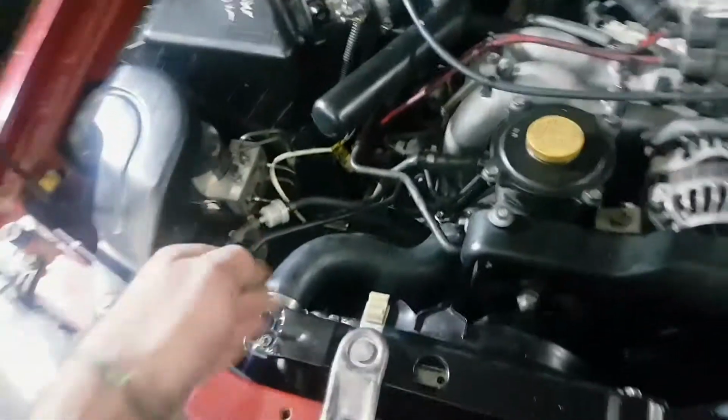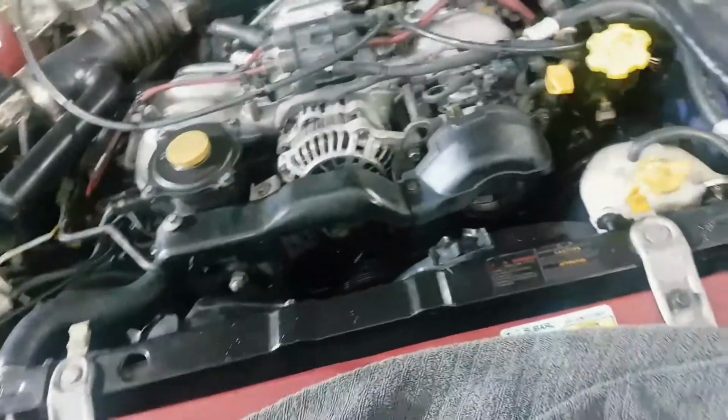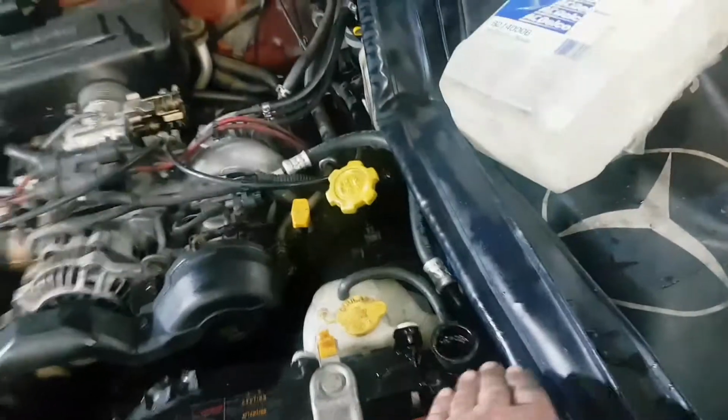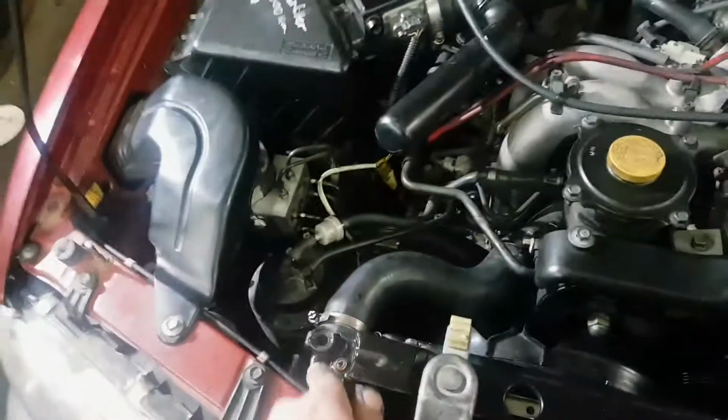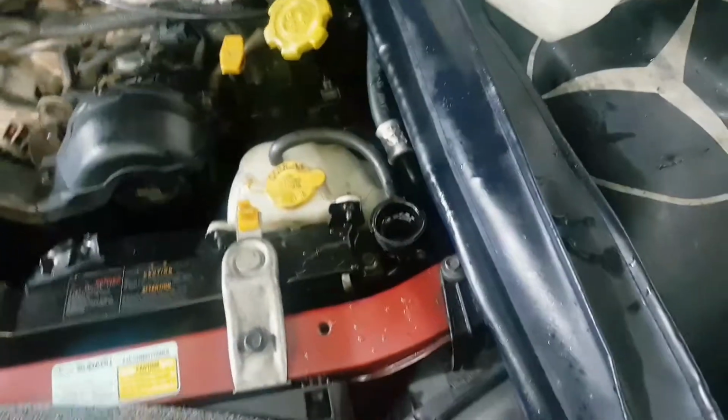So the car, about 10 seconds ago, finally... I mean, you can fill up water in there, fill up coolant there, and do an experiment: bring it up, open that, and you've got to fill this so slowly. You'll only learn how slowly you've got to fill that if you try and fill it through there, because you will put 3 litres through there easy. So it's to prevent air pockets, which is very, very serious.